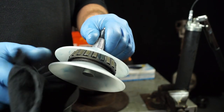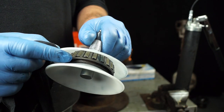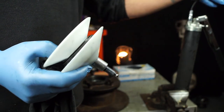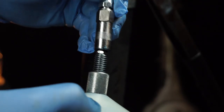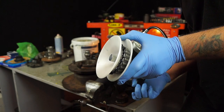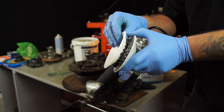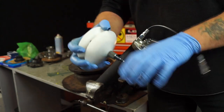If you look here, the grease can only come out of this section at the bottom. So as long as your cones are tight on there, it's just a matter of putting it to the grease gun. I've put the grease gun in the vise so I can hold this and show you with the camera what's happening. You can see the grease is coming out and being packed into the bearing in the right place.